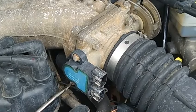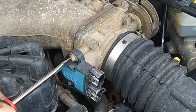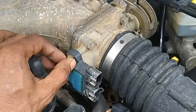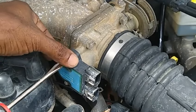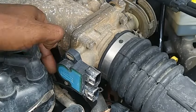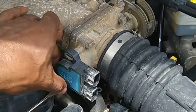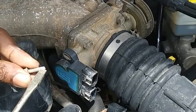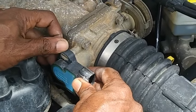In most cases you'll use a Phillips screwdriver, a flathead screwdriver, or sometimes an eight millimeter socket. When removing these screws, be careful because they can fall down into the engine valley — always keep a hand on them and place them in a safe area. It's always best to place some lubricant on the threads when reinstalling your new TPS.